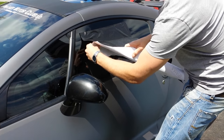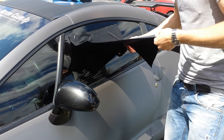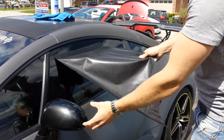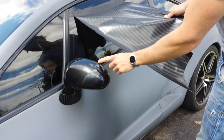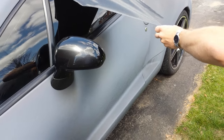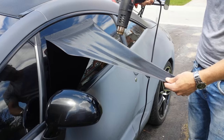The paper is just tearing because it's rolled up right now. The reason why I anchored it to the window is so that we can stretch this out before we actually wrap it around the mirror. The reason why we stretch it out first is so that when we heat it, it'll shrink around the mirror. That way you alleviate stress on your edges — you want to stretch it as little as possible around the edges so you don't get any pullback. We're going to heat this up. It's always nice to have a little bit extra. I'm going to gradually stretch this out.